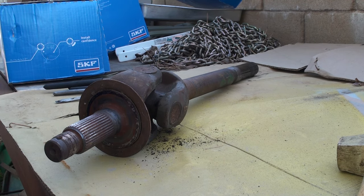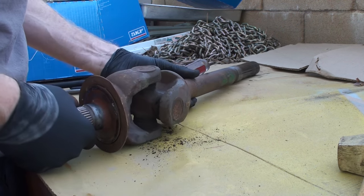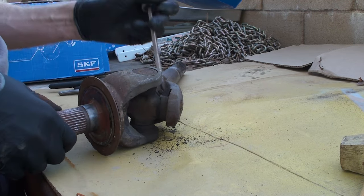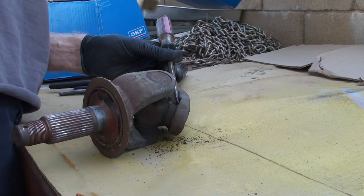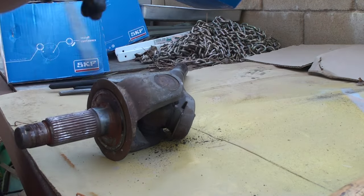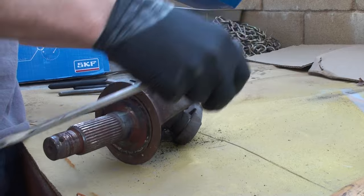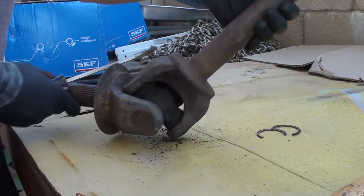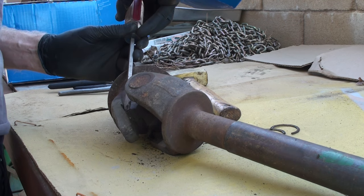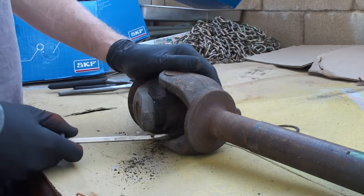The ball joints are on hold at the moment until I get the tool to pull them loose. I'll run to the store in a little bit and get that. In the meantime, I am working on replacing the U-joints. I popped one of these C-clips loose and I'm going to pop the other one here — basically you grab the C-clip and pop it loose. There's the second one. Now the other two are on this side of the joint.